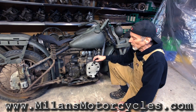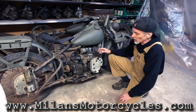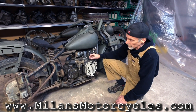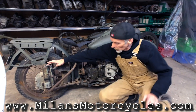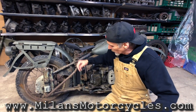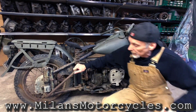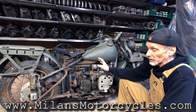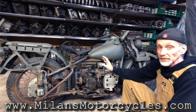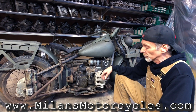This is also one of the first motorcycles where the engine and transmission are bolted together. The frame doesn't have many forgings — there are a little bit at the back and a little bit for the engine mounting on the bottom, but otherwise everything is welded from steel tubing. It's not brazed, it's welded together, which was also a new thing Harley-Davidson used.